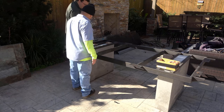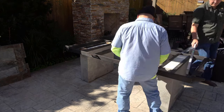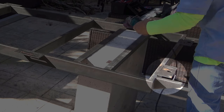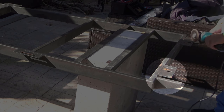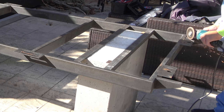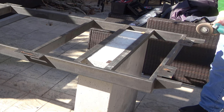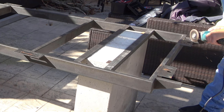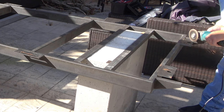I don't know if you just saw it, but the frame itself is slightly racked. When we went to put the last little bit of shims in there, one side we had to come up. I've highlighted right there those corners where the bolts go in — if you see the rust right there on the corners, that's rust from where the rail bolt was setting right against there. The last guy just kind of had the rail bolts pushed in there because he couldn't make it past that bracket. So what we're doing is going in and clipping off the ends — just the corner — of each one of the brackets so that we have clearance for our rail bolts.